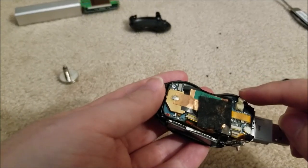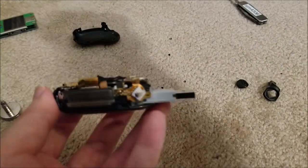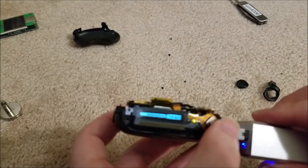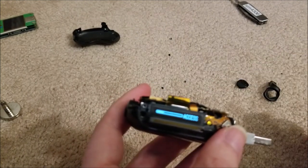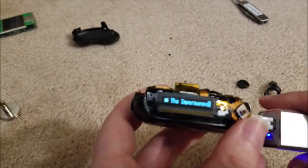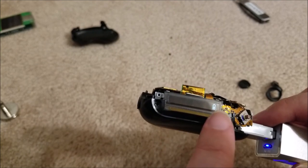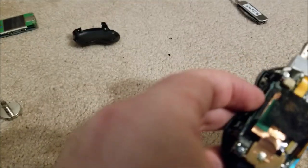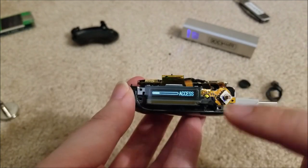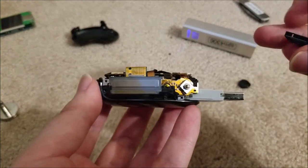So now we're going to do a quick power-on test. This is the battery connector. I finally got it all back together. Let's see if it powers on. Maybe because I disconnected the battery, it might have gone into some power-down mode. Yeah, looks like it — it's saying low battery, but if I disconnect it should boot up now that the battery is reset. And you can see it's there. When I plug it in — there we go, it took a second — now it connects and it does charge. You can see the charge indicator is going, so USB works once again. The mechanism still works.